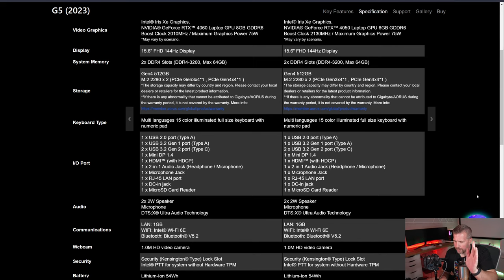So let's go ahead and test our display, because I really want to know what the nits brightness on this is, what the color gamut is, and the contrast ratio, so we know what we're dealing with when it comes to display quality. So we're going to use my Spyder 5 Elite. I've already installed it and got it set up. This is a tool that's designed to test the quality of laptop displays, or really any kind of monitor display. So we're going to set this back. We're going to go into display analysis. We're going to do gamut and brightness.